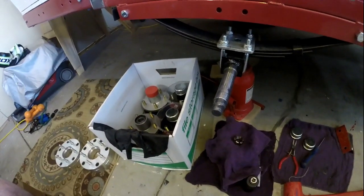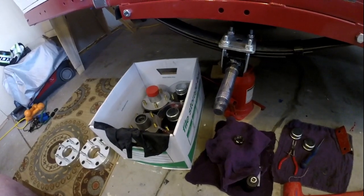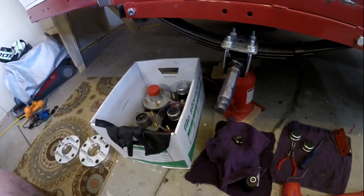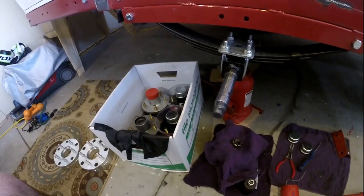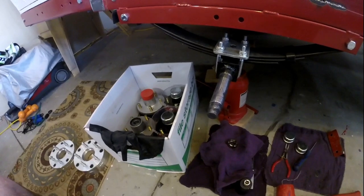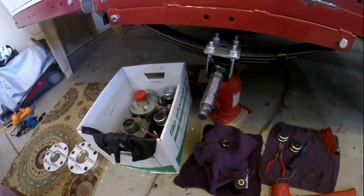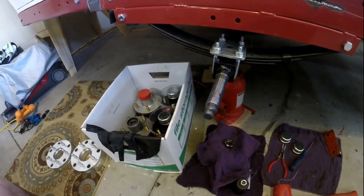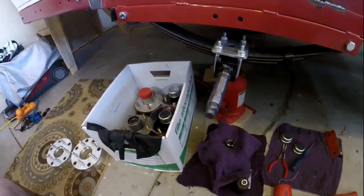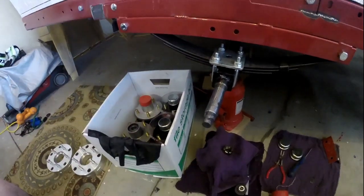What I'm going to do temporarily is put a washer on this side of the castle nut, hoping that the little notch for the cotter pin ends up in a different place with that little extra width. That's going to be my temporary solution. It makes a lot of sense that maybe I should have started with a bigger, beefier trailer. But I thought I was in love with the idea of this little $200 Harbor Freight trailer and let's turn this thing into something cool. For me to feel good about it and tow it on long distances — like I'd like to go to Mammoth — I don't want to have to think about Mickey Mouse-ness. I'm going to find some washers of different thicknesses and shims to see if I can play with where the castle nut ends up in relation to the tightness of the bearing.